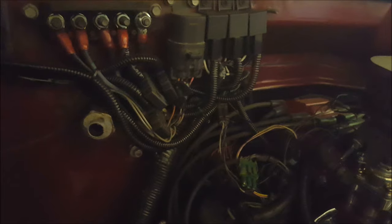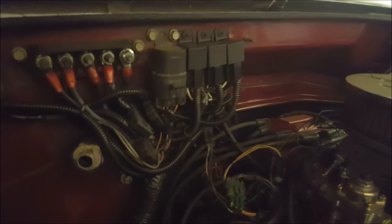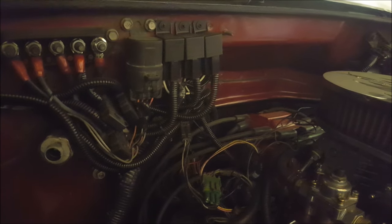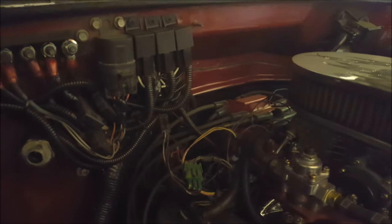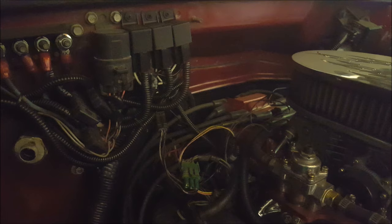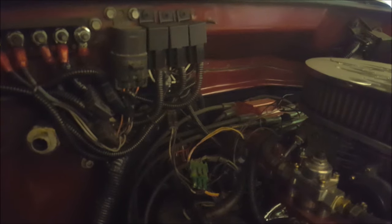I'm going to do this on the bench to give you a better idea of what that looks like. Also, when you're wiring up your own fuel pump, it is recommended that you use some sort of inertia switch or an oil pressure feed. What the oil pressure feed does is — when the motor starts to crank, the oil pressure gauge will actually send out a signal allowing the relay to turn on. This is a safety precaution: if you're driving and get into an accident, the motor would usually stall. So if the motor stalls, or if there's impact with an inertia switch, the pump will stop pumping — because in an accident where the fuel line were to rupture, the pump would continue to pump fuel. That's something you'd want to look into. But today I'm just going to show you how to wire up the pump by itself.